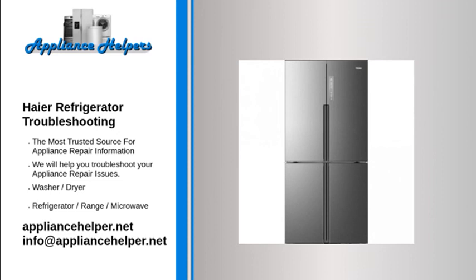Haier refrigerator running too much. Modern refrigerators save energy by running longer at a slower speed, as most energy is used when starting the compressor. Factors that contribute to running too frequently include: initial installation or a long power outage, high humidity or high room temperature, frequently opened doors, warm food placed in the compartment, and a damaged door gasket. Check the gasket for a proper seal and make sure it is not damaged.